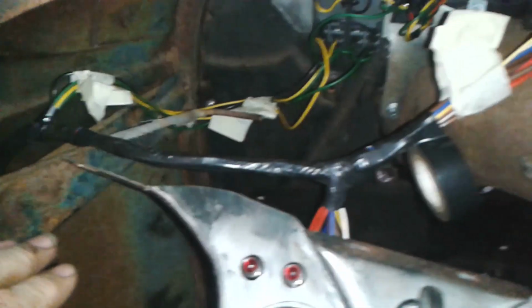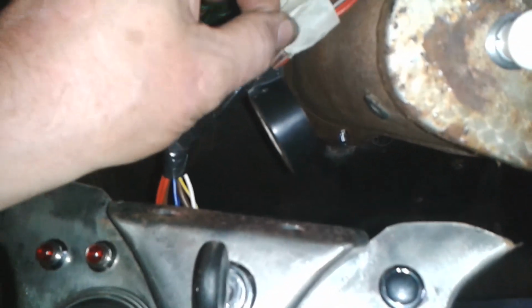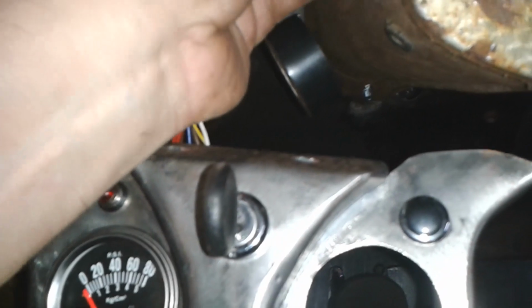I carried on winding, actually. I didn't really intend to do that, but I thought, well, I'll bind this bit that goes up here, because to be honest, that's the only bit of the harness that's on show. Without really intending to, I've carried on up here and got to this point, and I'm just showing you that I had these temporary things. I had some made out of insulating tape and some made out of masking tape, and they're easy to undo and take off, and then you can bind them properly.